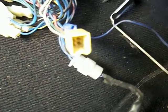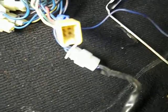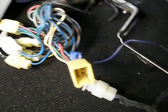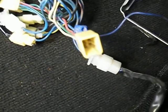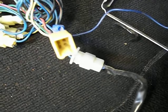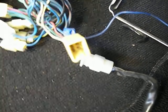You can see where I have all the speaker wires pulled apart. This is the factory connection right here. You can see somebody's already put a blue power lead in it — that was for the aftermarket stereo. I've ordered enough parts that I should be able to tap into this to use the power lead, the light lead, and all the other stuff for the aftermarket stereo, so I won't have to have that blue wire — I'll just leave that alone for future use. The two stereo speaker wires will come out here and I'll hook them up to an adapter. The whole idea is to have everything be as close to plug and play as possible — no hardwired connections; it should all just plug into the radio. I ordered the correct plugs to go with the Datsun stereo radio that's coming, so I should be able to do as close to plug and play as possible.